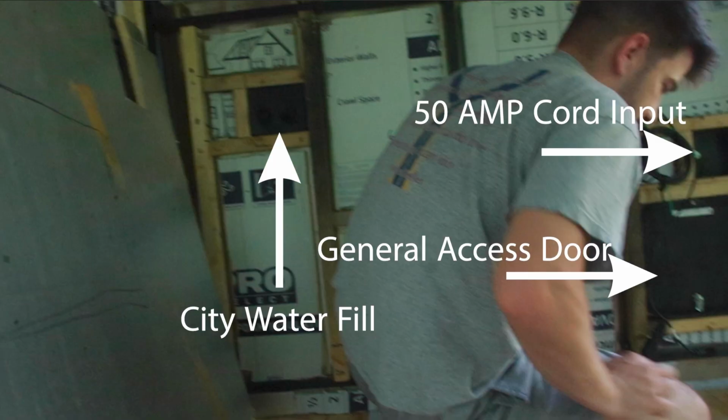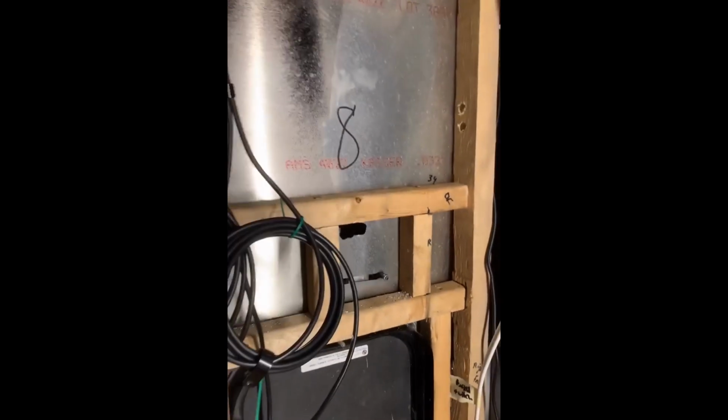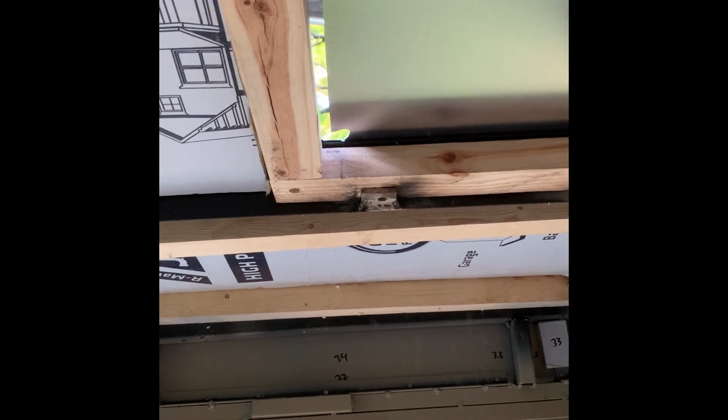Notice on all the access doors, we used existing structural supports and framed out the hole with wood to prep for installation. So we started by drilling a hole in the corner and then using the router and the frame to guide us to making the perfect cut. Voila. On the back side of the panel's lip, we use VHB tape and then eventually screws and caulk to tie down the doors.